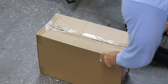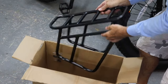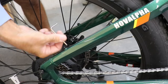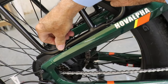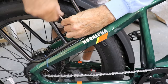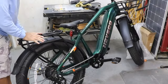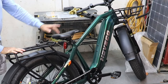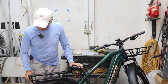Let's move on to the back cargo rack. It's made about the same way — heavy aluminum tubing welded at the ends with lots of cross bracing. It straddles the top of the rear tire and goes on with pre-drilled and pre-tapped mounting points. I replace the small bolts with the larger bolts that come with it and put a little — well, a little too much — of that thread lock fluid, then snug it all down. I think I'll use this back rack for the cooler and the front one for a bait bucket and cast net, and then attach the rod holders here too.